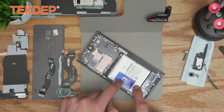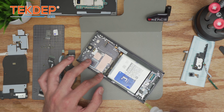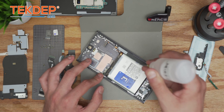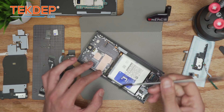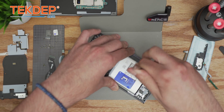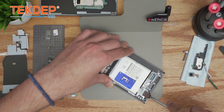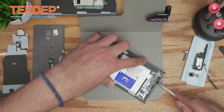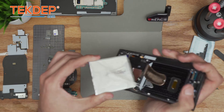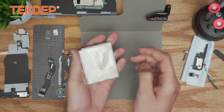For this type of screen there's not really a recycling option, so it's best to toss it unless you have a cracked screen with a perfectly impeccable LCD, then you might have options. Lastly, the battery: two ways to go — isopropyl alcohol, pull tabs, or both together. I prefer to use isopropyl alcohol and a prying tool with a concave tip. You don't need heat unlike what most people think — just use the proper tools. Even if it bends a little, as long as it doesn't puncture you can spoon it out.